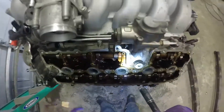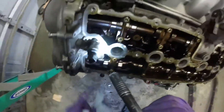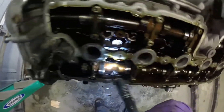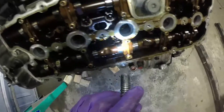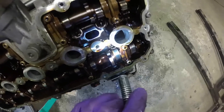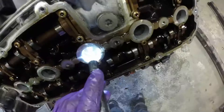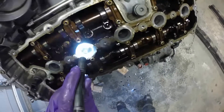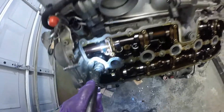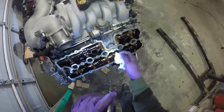To get this upper carrier off properly, the fuel pumps have to come off and then the timing drive also has to come off. I'm going to remove the phasers from here as well, along with the oil control valves for the phasers, and put new o-rings on those. I'll mop up some of the slop. The camshafts look alright though — no major scoring or pitting, no asperity contact. The hard part is actually getting all that oil out of there — I've got to put a little oil suction tube in there for oil extraction, and definitely going to clean all this super well.